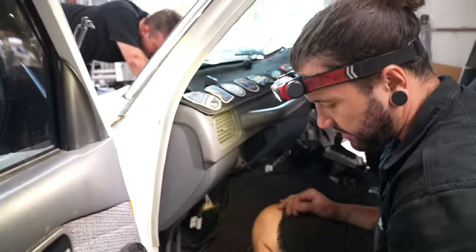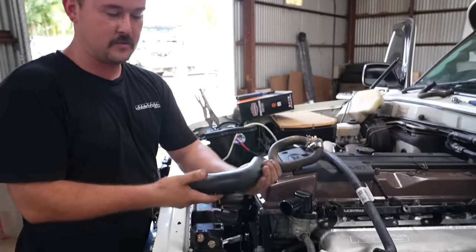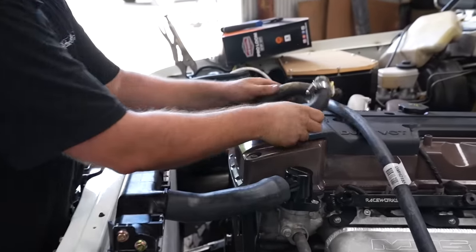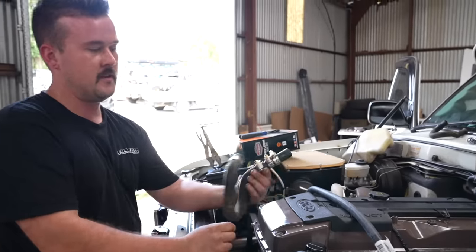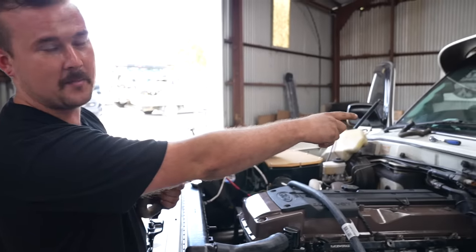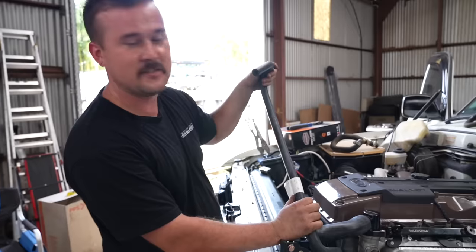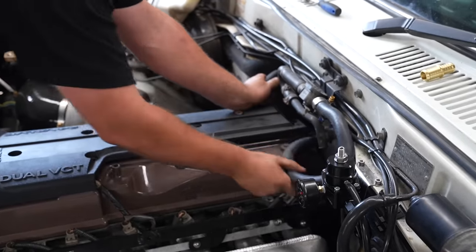All those harnesses will be tucked up behind the scenes. Ran down to Bursons and got some parts — heater hoses and radiator hoses. Top radiator hose is just off a Subaru Forester two litre — it was a bit long so we've cut it and made it fit. Simple as that, top radiator hose done. One of the heater hoses was off the Territory — it was a transmission or oil cooler hose, and the Ford has a bigger hose than the Toyota's heater hose, so there's a little brass barb reducer with a straight piece of hose clamped in. Then a VR Commodore hose — most common car in the world — which goes from over here, down around the back, all the way on. Two jobs done, a couple more ticked off.